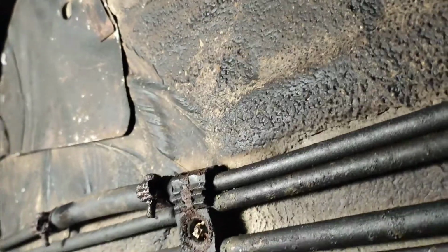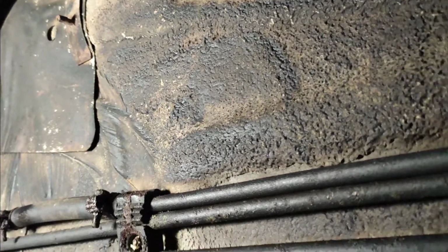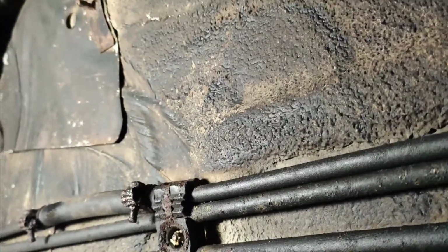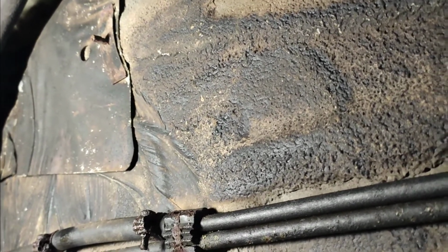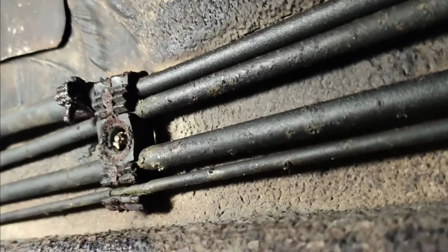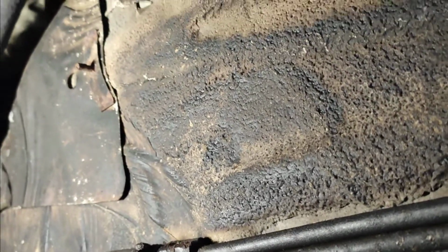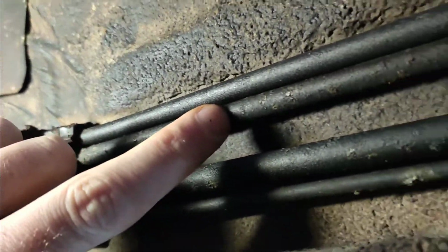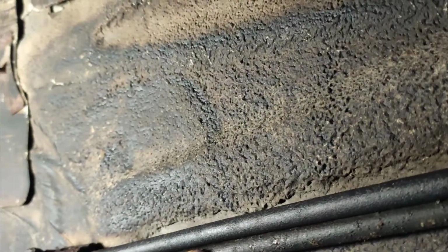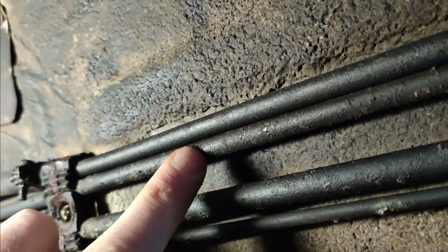So what we want to do is give ourselves enough wiggle room so that we can pull this pipe down and, A, see if there's enough sound metal to do anything about it, but B, use our little pipe cutting tool to cut it off nice and square, somewhere around here, clean it up, and then use the compression fitting to join it to the sound pipe.